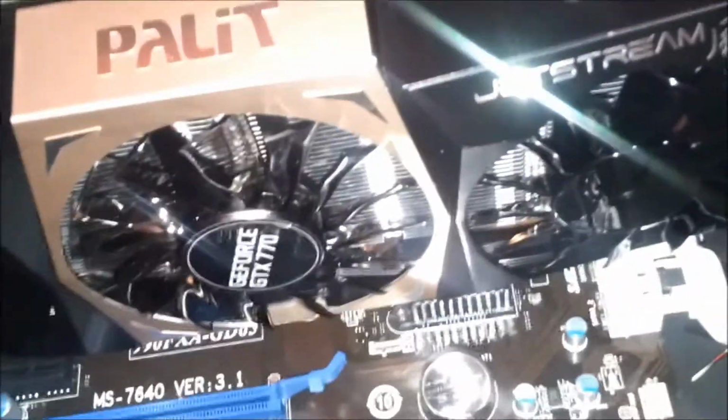Right, next is to put in the disk drive, my one disk drive, and my two hard drives. And then I think that'll be it, apart from the power cables needing to be moved to the right locations. So, I'll be back in a second when... Actually, I can just do the hard drive. I'll do one of them right now. So, we just take this hot swap out. There's the hot swap, and then it's real simple to go in.